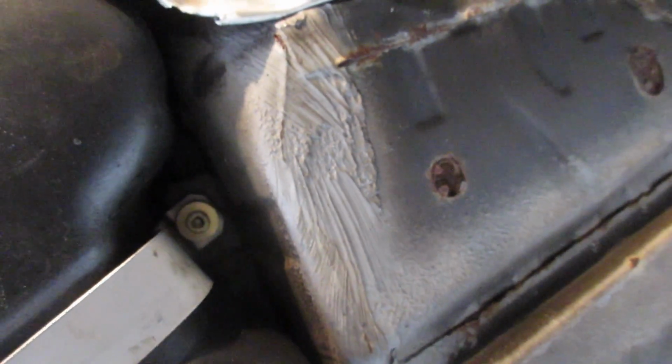Same deal. Slide it over the hinge. Use your new 6 millimeter Allen and tighten her down right there. No specific torque spec. There's rubber grommets in there, so it's kind of spongy. And honestly, these fuel tanks seem very, very solid in here. I don't think that's fully responsible at all for holding it up like people say, but maybe mine are just seized in place or something.